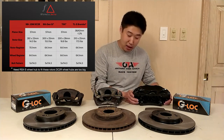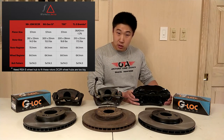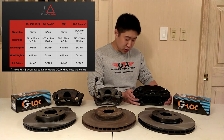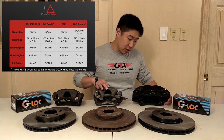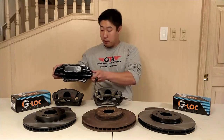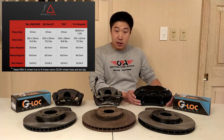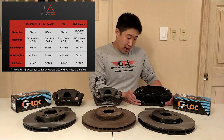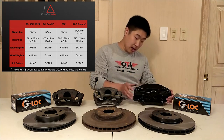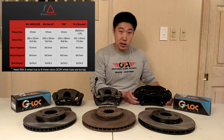If you want even bigger, here we have the TL Type S caliper — the Brembo caliper. This is a two-piece aluminum design bolted together with four pistons, staggered sizing at 38mm and 42mm. When you calculate the difference between that and the 57mm single piston, it is only about one percent smaller. However, with the larger brake caliper and the fixed aluminum caliper design, it is going to offer more rigidity and more immediate feel.